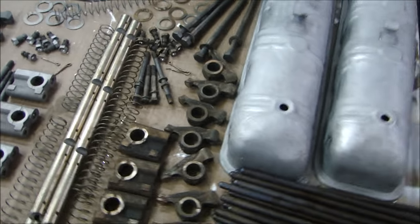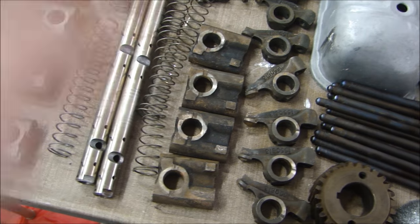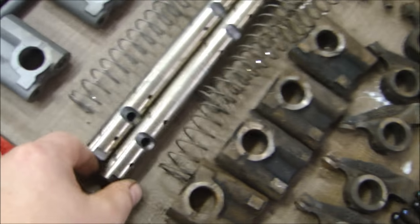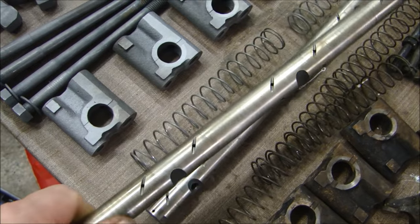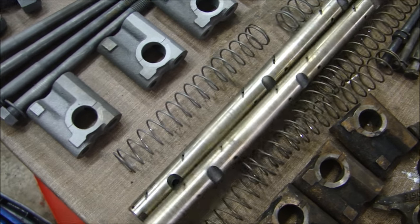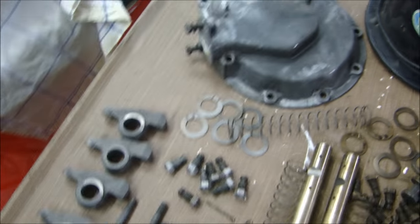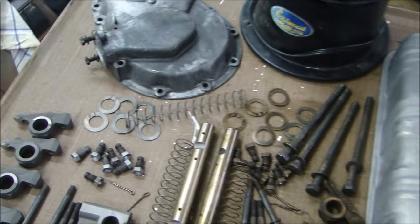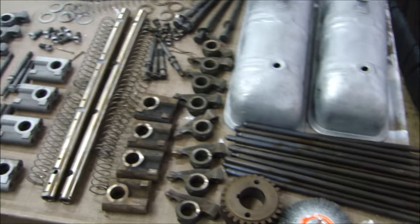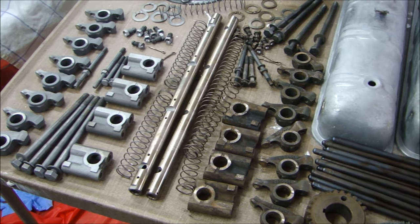So those are the cleaning methods I use: chemical stripping, rinsing with water, soaking in a parts cleaning solution, then baking to carbonize the oil — it actually turns into carbon so it's easy to come off. These parts I did by hand — just ran them through the parts washer, then cleaned them. Since this is a polished hardened steel part, I just cleaned it with a Scotch-Brite pad. And then bead blasting or wire wheeling after, plus oven cleaner with water. Those are the basic methods — and you can use them for any part you take off your engine. The objective is to get your parts as clean as possible so when you assemble your engine and put it back together, you're starting with all fresh, clean parts.